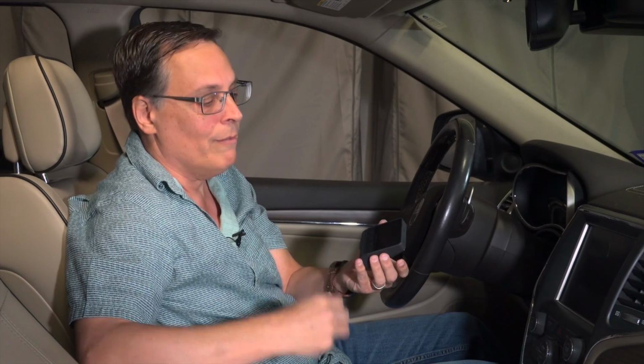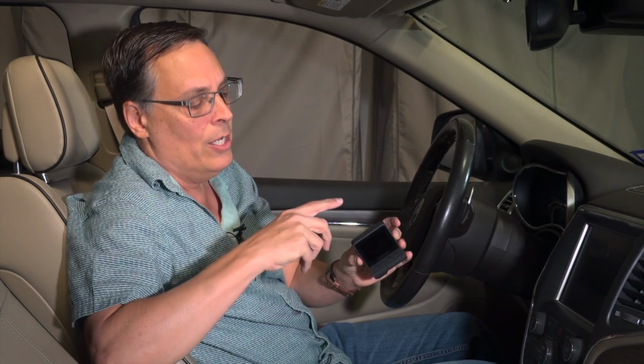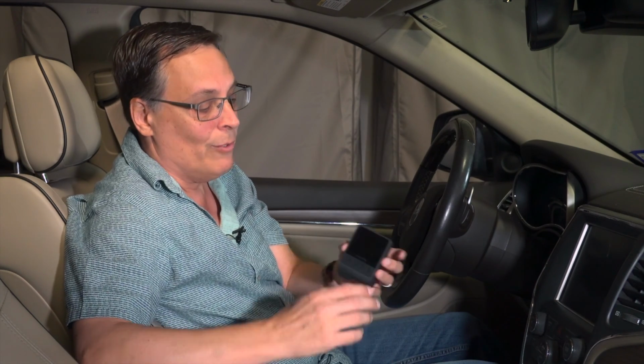Now, the DDPAI Z50 here works a little bit differently, but it does give us essentially 3 different options for parking mode. Now, the first option is if you just don't want parking mode. In that case, you just wire it up to a power source in your car that turns off when the car turns off and it turns back on when the car turns on. That way your camera just turns on and off every single time. No parking mode, just powers up when the car is powered up. That's fine for a lot of people.